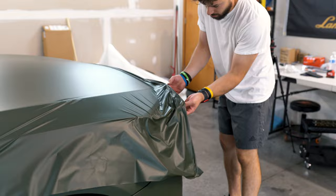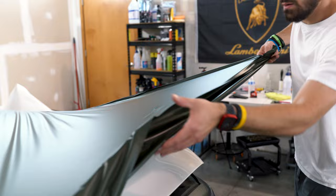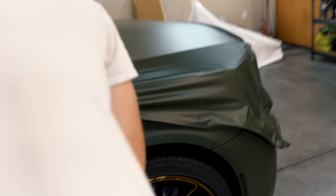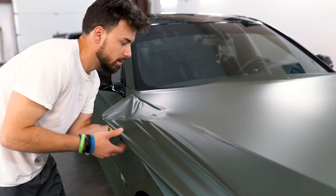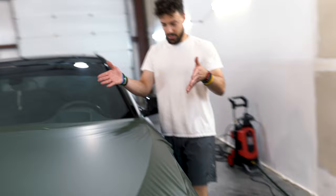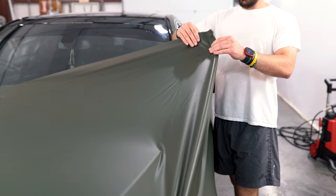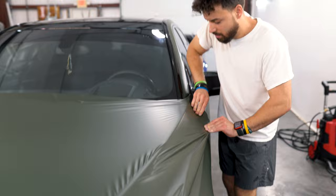Take this piece, give it a little shimmy, and lay down to here. When you have a recess like this, don't just pull across — you're going to create what's called an adhesive dot. Make sure you pop the vinyl up right here and then lay it down. For the other corner, all fingers are going this way. I'm taking the corner, popping it up a little, holding it and applying pressure on either side of the point, then giving it a little shimmy down.